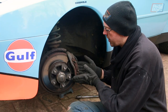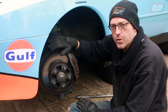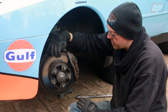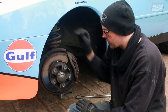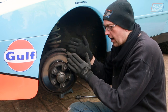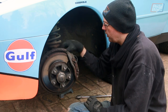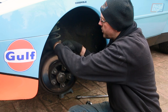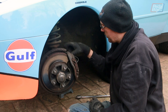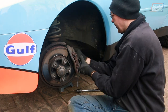The caliper needs to come off first. Because these are quite well worn - we've been trying to do this brake swap for at least 12 months - there's a big old lip on the disc which is currently retaining the pads, and we can't easily push them back without having the caliper off. So we're going to pull the wear sensor off first, get that out of the way, and then start taking this apart.